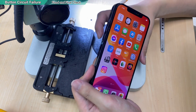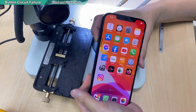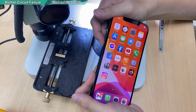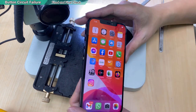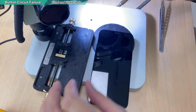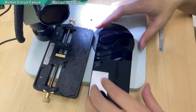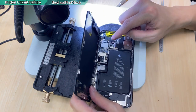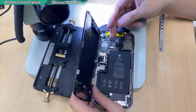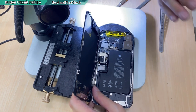Let's do the button test. Volume down is working — no problem anymore. Up and down both work. That's how you fix the button in a fast and easy way, but it also means losing the protection. If any water damage comes through, there's a chance the damage will go beyond this line — the power IC will be affected, or maybe even bigger things, even the CPU can be affected.